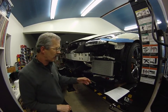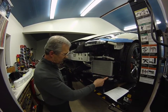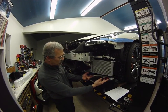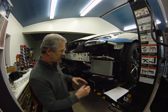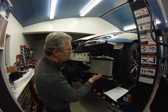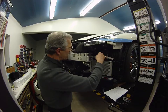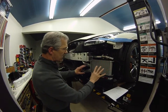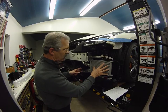All the fittings used in this operation are 8AN. The fittings on the cooler are 8AN, and up front, two 90-degree swivel fittings were used to attach to the cooler. I started with mounting the cooler — you need two oil cooler mounting brackets. With those, I was able to attach to the hard points on the framework. Once that was installed, I did some framework for the ductwork so it would fit perfectly over the cooler.